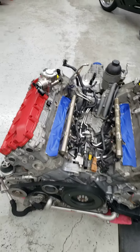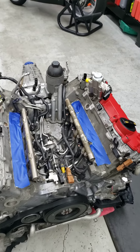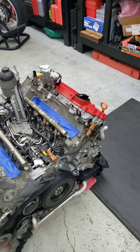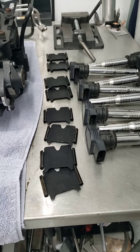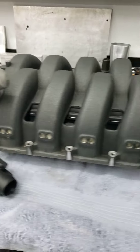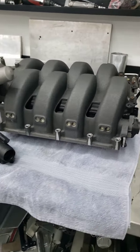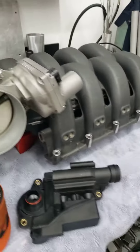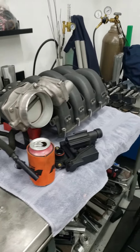There's a little bit of carbon buildup so I'll do a quick carbon clean while I've got the manifold off. I've decided to pull the flaps — I've already pulled the port separators and I will remove the flaps from the manifold, because the e-boosters will be able to make up for any low-end torque that is lost from removing these flaps.